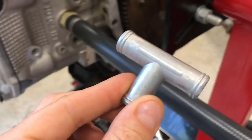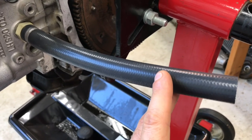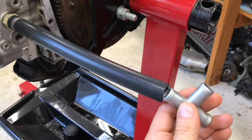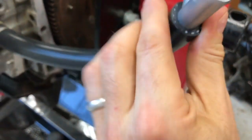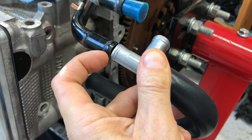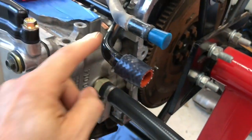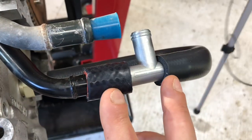Then grab that T-fitting and connect it to this rubber hose we screwed in. Depending on your make and model, you'll actually need to trim this hose to the length shown at the bottom of the instruction sheet. Don't forget to install the hose clamps. This goes around and ties into your heater core circuit — specifically this black hard pipe — with a little hose section connecting the two. Then you'll have those hose clamps on all the fittings.